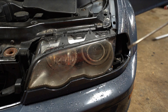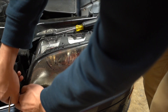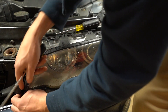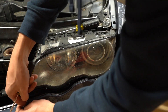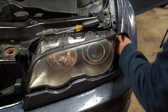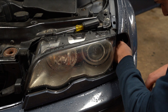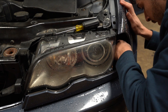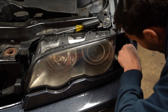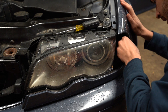The next thing you need to do is remove the bottom clip — it is kind of difficult to remove. What I recommend is pulling on this side to get it out a little bit, then for the other side take a flathead screwdriver, put it inside of it, and push all the way in to the inner clip. If you have one of these cars you probably know how to take it out.